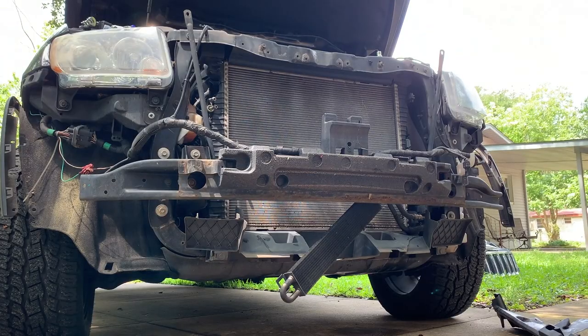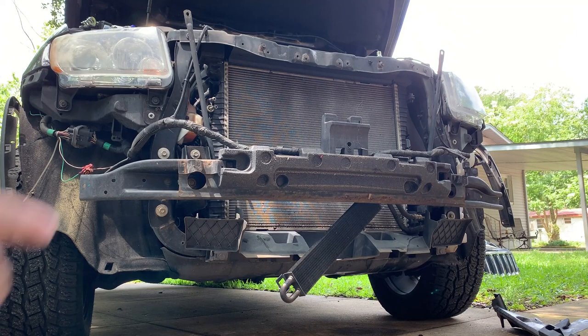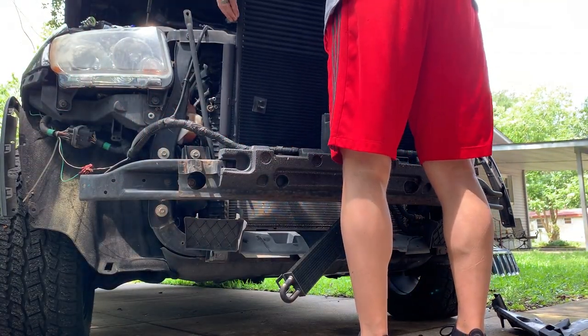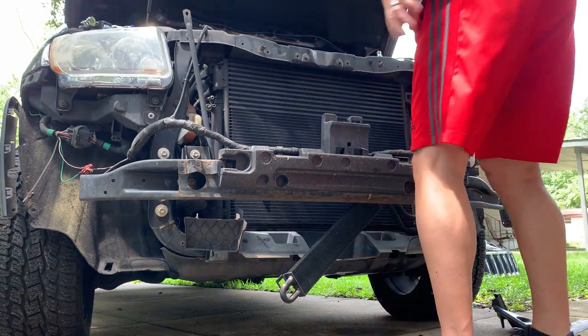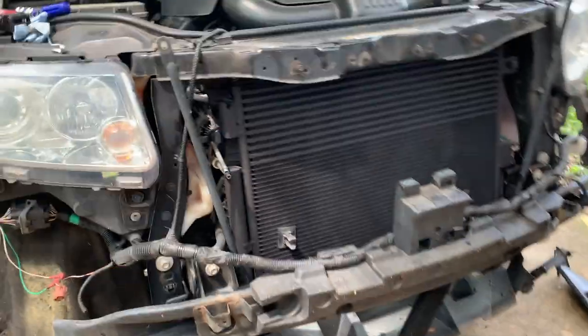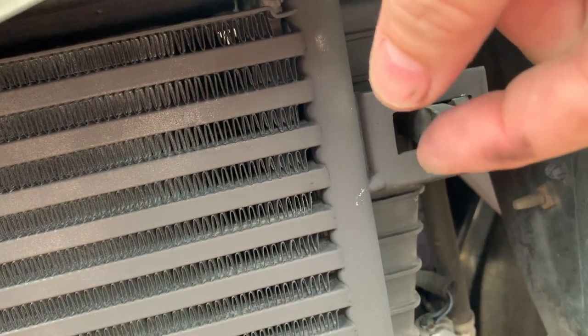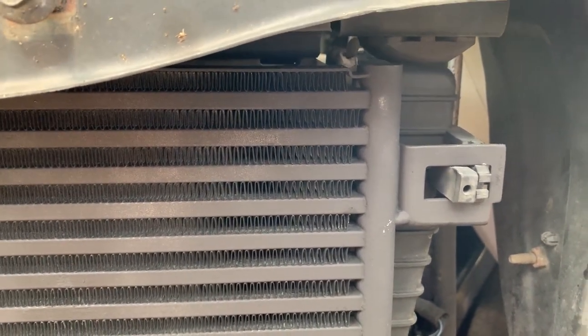So now we're gonna put it in. When you put it in, there's a couple spots on the bottom on this side and on that side that the condenser will rest in. And then remember up top, you'll have the little clips that it pushes into. So here are those clips I'm talking about. You get this guy and see if we can get a side view. It's got just a little, kind of little dog that catches on the top of that. And then this guy here, this is the piece that snaps in and holds on this side. I don't like the way that top one looks, the bottom one looks like it's okay. See if we can pry it up a little bit more, but that'll be about what we're gonna go with.